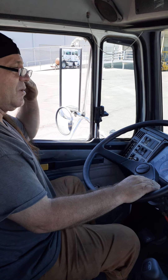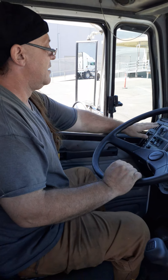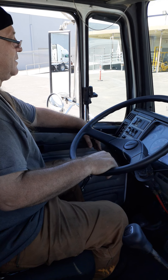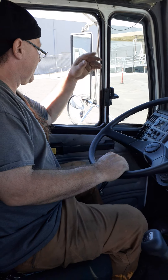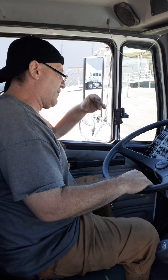He's going to move to the rear of the vehicle and check both sides of the trailer and underneath to see that the tractor lights are all working. In a loud clear voice, say clearance lights, marker lights, and tail lights. Once he checks one side, back, and underneath, he'll give you a thumbs up. Check him in the mirror, then shut those lights off — he doesn't need to see your headlights; he's in the rear.